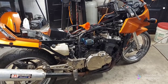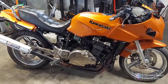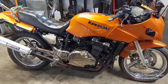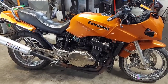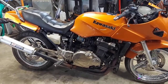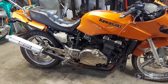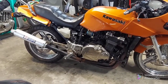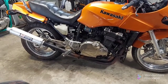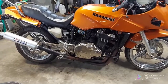So I was able to get it started and running — it actually tried to idle. But it was definitely over-fueling the motor; the floats are stuck open. The carburetors are angled toward the engine, so they overflow and it goes straight into the motor. What you saw coming out of the tailpipe wasn't all fuel, but a lot of it was. There was also a bunch of water in there from sitting outside. I really don't want to do any more damage to the motor.